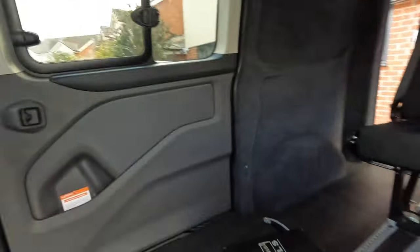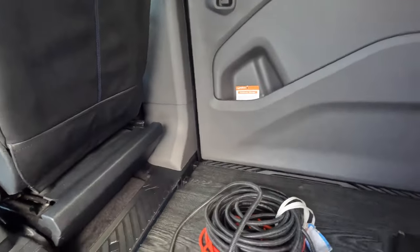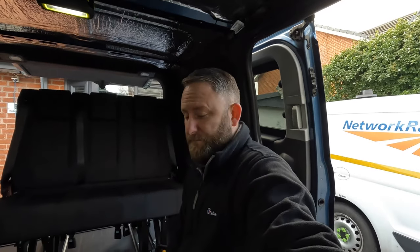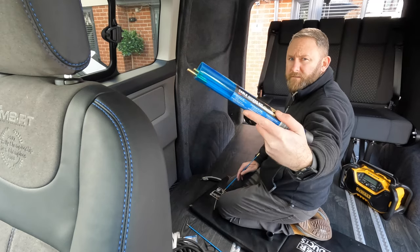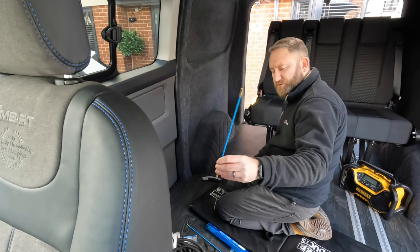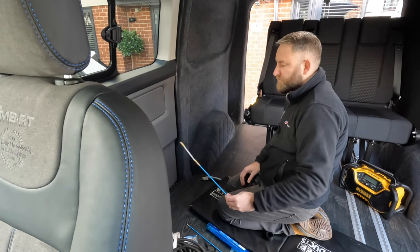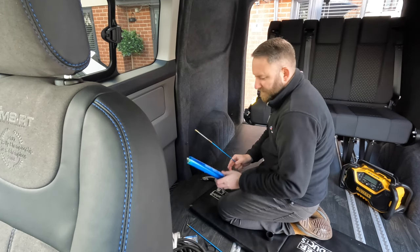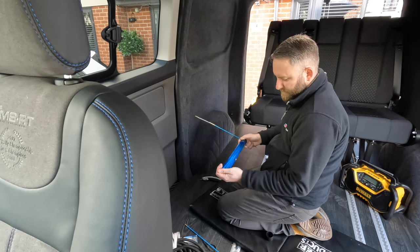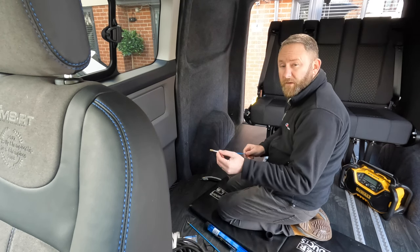So I've decided the leisure battery is going under the driver's seat because the cable's a bit short. I should have done it before the carpet went in. I've got these cable run chasers - absolutely brilliant. Basically you get a lot of these rods with little brass ends that screw together. They flex, which gives some movement, and you run your piping up through there with various attachments - hooks and stuff - to pull your cables through.